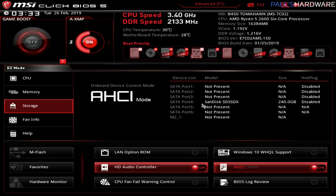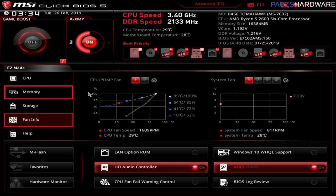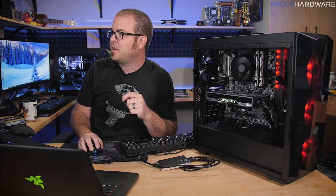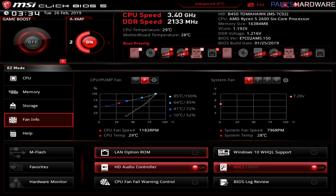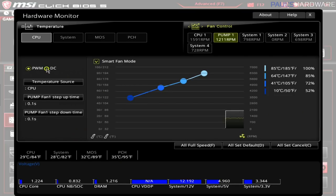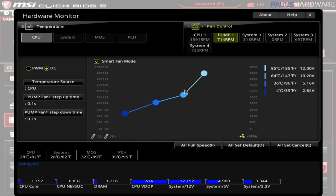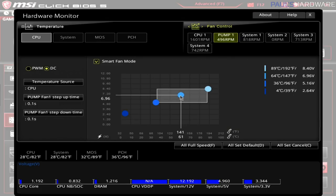Going down to storage, I'm double checking to make sure the SSD I have installed is being recognized — a SanDisk 240 gig, and it's right there. Our SATA controller is in AHCI mode, which it should be by default, but that's something good to double check. One last thing before we back out is our fans. I notice one fan in particular is running a little loud — it's plugged into the pump fan header. I'll click on that pump fan, click the gear icon, and make it slower. It's only a three-pin plug, so it does not have PWM — that's what the fourth pin is for. I'm going to switch to DC mode and move these points down so it runs at a lower RPM at a lower temperature. I'm just keeping it simple for now.